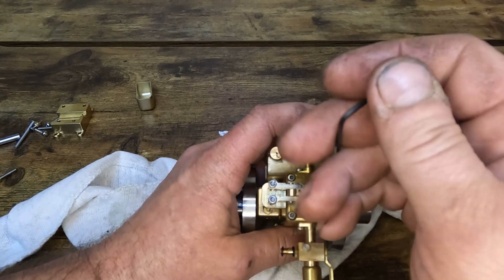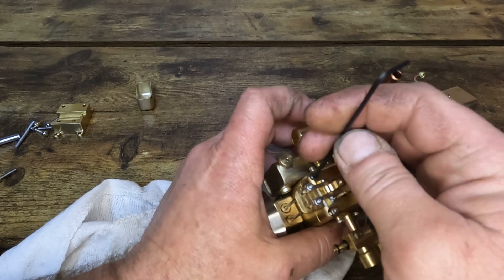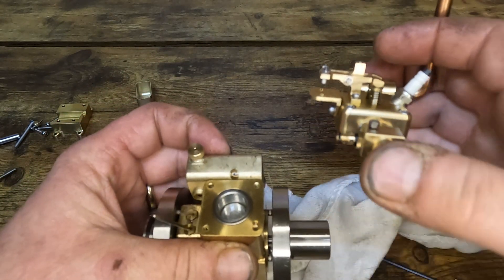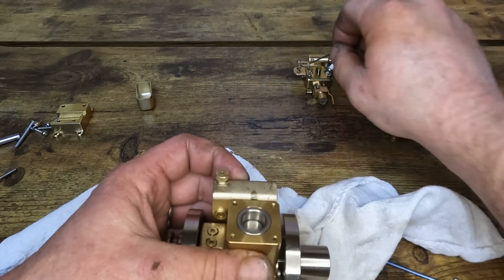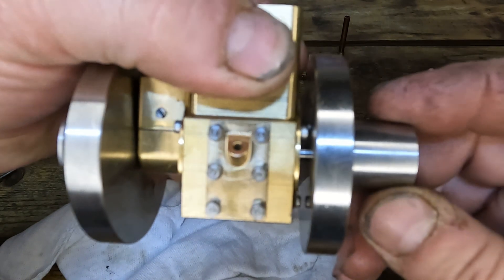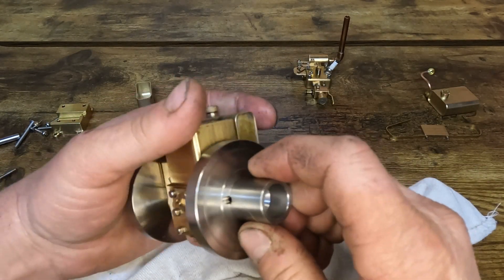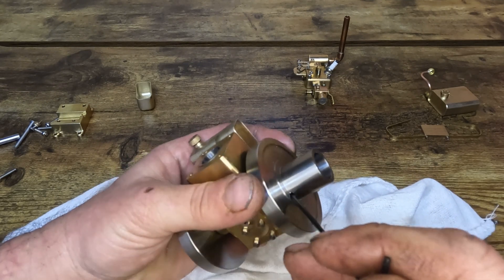Let's see — this one in here wasn't even tight. That one was loose also. Alright, let's lift our cylinder head off the block here. We'll keep our push rods — exhaust with exhaust and intake with intake. It may be okay but I'd rather be safe than sorry. These little models aren't cheap, so if we can address the issue before it fails, we're going to.